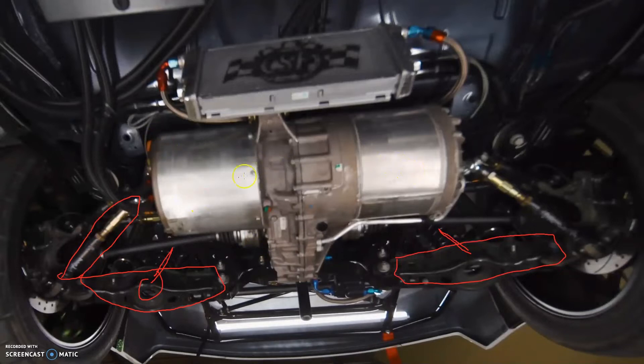They were talking about flipping the drive unit upside down. This big thing here on the front of the drive unit is the inverter on this side, and the motor is on this side. It doesn't matter which way up it goes — you can flip it over from how it is in the Tesla, putting the inverter and motor to the inside of the car to make the weight distribution better. Getting those two black power cables coming into the inverter side away from the back of the car is a lot safer as well, so that's why they flipped it over.